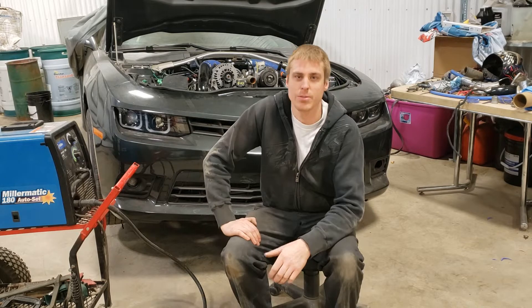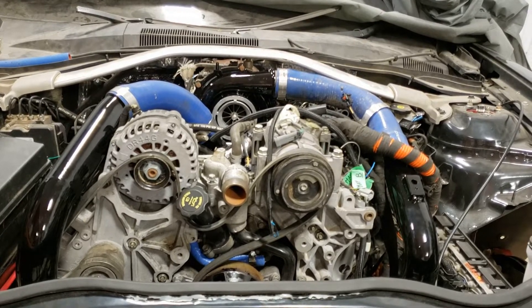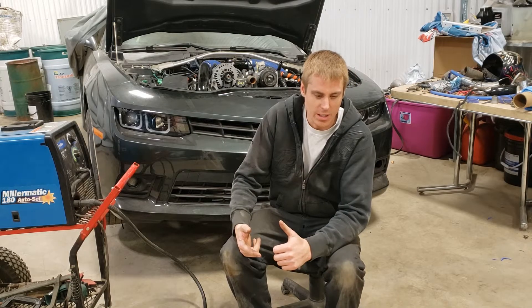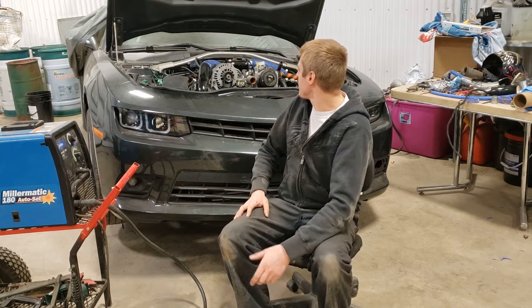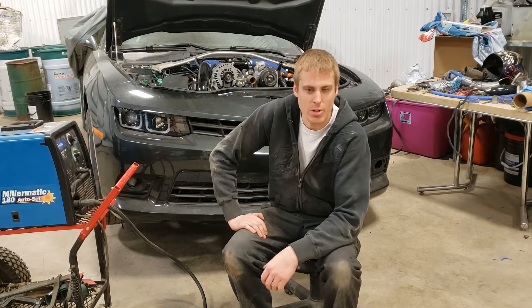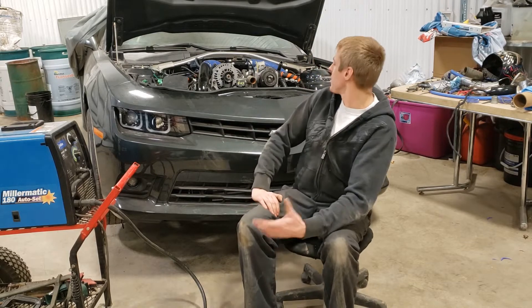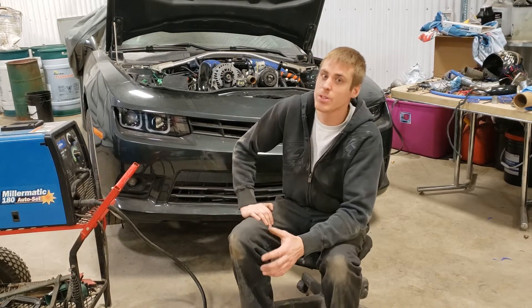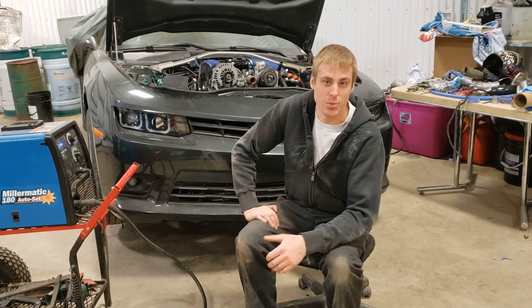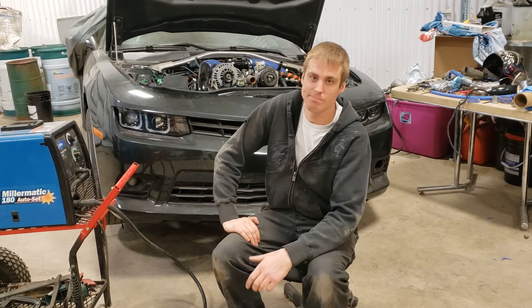That's going to wrap it up for this episode with the boost tubes all done. Back on the car it's actually looking pretty good. Next episode we'll cover transmission coolers, fuel lines, and a bunch of little things to catch up to where the car currently is - most of the electronics are done. We'll also touch on the EFI Live tuning I had to do, and I had to order an MDI interface to re-sync the immobilizer so the car will start. It's very close to starting right now - that first-start video is coming soon, and then a little tuning will make this thing whistle like crazy. Don't forget to subscribe and hit the like button. See you next time.